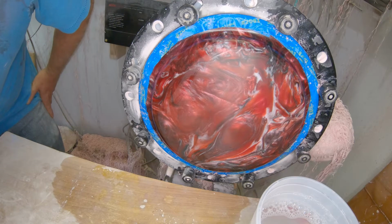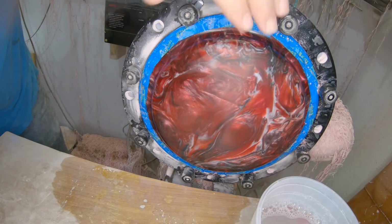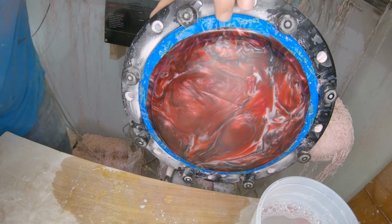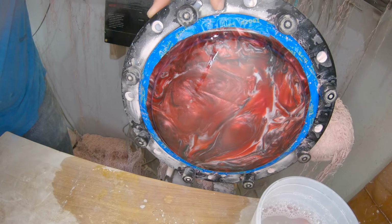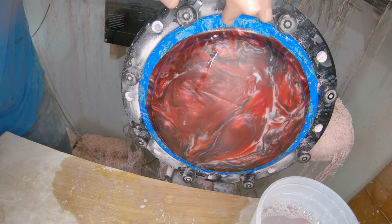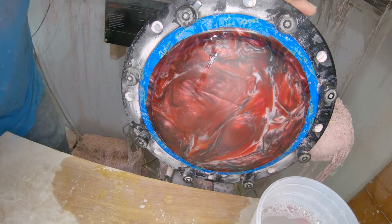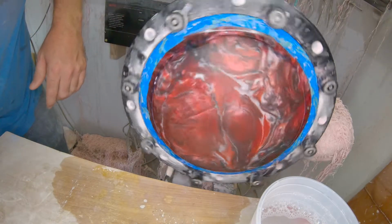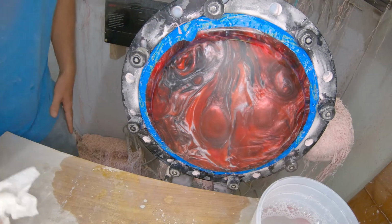That's how it looks at 2000 grit. No scratches, nice and smooth. And I put the tape on here because I didn't want to mess up that rim, or mess the edge of the rim with the face of it with it sitting down like that. So I'm gonna get all this out, get the buffing pad compound on here, and I'll explain that part too.